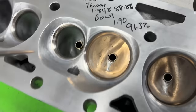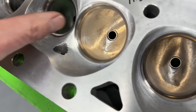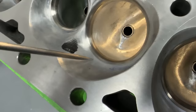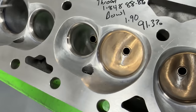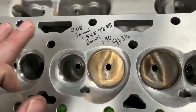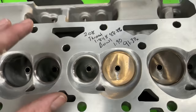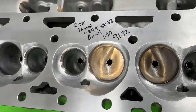Now let's look at the chambers since we're on this view. He did a nice job. There's a lip right here, but it's barely noticeable at all. What you want to do is get rid of the lip right here - you left more of one on this side, but it's not bad. You want this to transition right into the chamber without any step. This is very, very, very small, so that's not bad at all - it's actually pretty good. This side's a little bit worse, so work on that. Anything you do to the chamber, you're giving up compression ratio. So you better have a big gain in CFM because you're going to lose on compression ratio. Dyno results show compression is worth more than flow. Taking out this little lip, you're not even going to lose one CC of volume on the chamber, so definitely get rid of those.